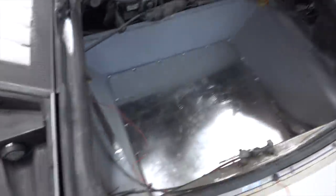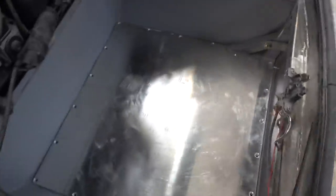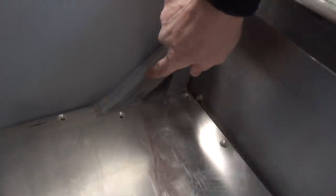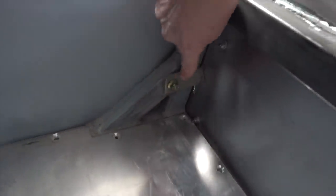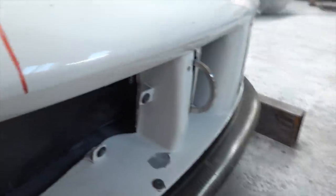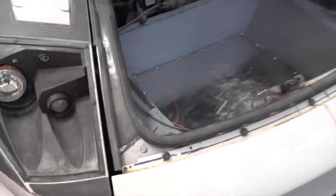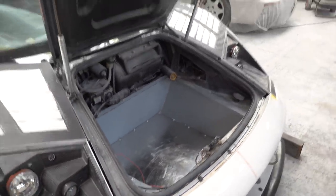So in here you can see it's not finished yet and there's still quite a bit of work to do. On the inside you can see we've got an aluminium plate for the floor at the moment — six mil, which is pretty tough. That'll be sealed in all the way around. You can see the tow hook, which has been finalized — Craig created the structure and Gaz determined where it needs to be and mounted it securely. You can see all the work on the slam panel. The rubber seal is super important, and getting the right amount of pressure on it is critical to make sure you don't get air underneath the bonnet.